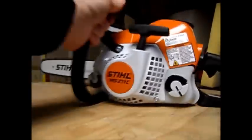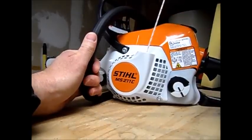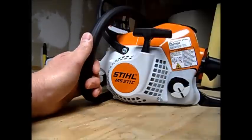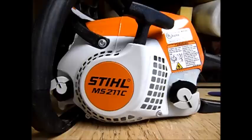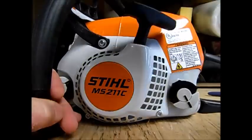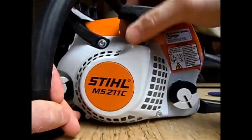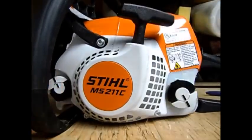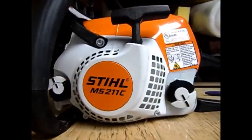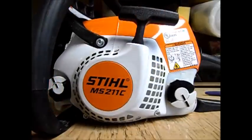The pull start is another cool thing. What they've done is when you pull this slowly, you're winding up a spring — it's not really doing anything yet. When you pull slowly it winds that spring up tight and then it starts the motor up. Here's a good showing of how this easy-to-start function works. There's a recoil spring in here — I'm going to wind the spring up and then just let go. That's what it's doing: winding it up and turning it over. If you just yard that out a bunch, it's probably going to turn it over four or five times.